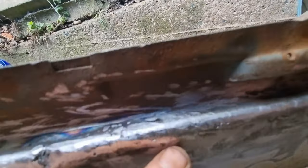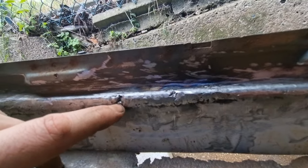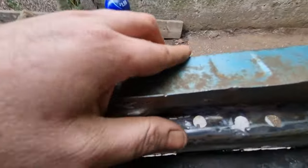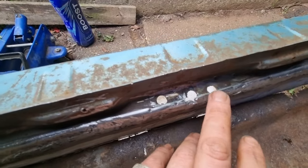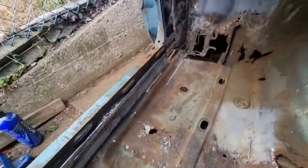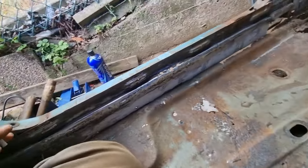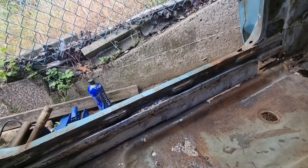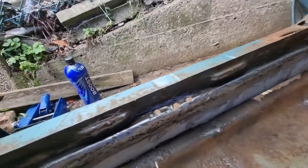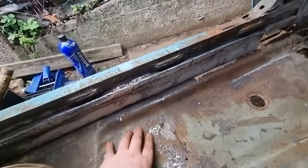Perfect welds — look how smooth. You can run your finger around the edges. I've got to get a little bit more grinding done, put a little bit of filler there, grind the edges. These are where the brace goes — I've got to weld them up and I've left them for now because I want to use them as a guide of where it goes. So when I've lined it up ready to put back in, I will fill these in. That's been today's job — I started early this morning and I've just finished now. There's a lot of welding going into that, all the way across smooth. Solid — as soon as I weld the new section of the floor in, this side is going to be solid. Really chuffed with that.